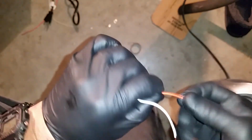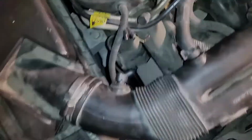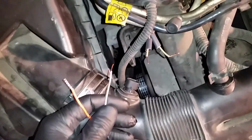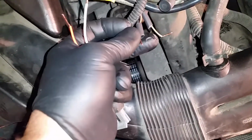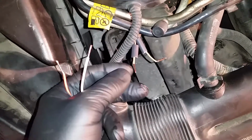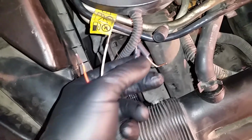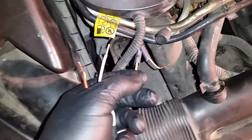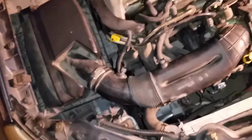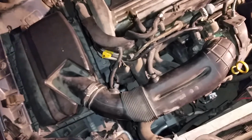What I'll do is I've got the wires on the car ready. Okay, now I'm going to put the wires back together and solder them, and then I've got, you can see, my marine heat shrink tube here, which after I solder them, I'll put this over there and melt it, and they'll shrink down, and it's got adhesive to keep the elements out. And then after I'm done with that, I'll take friction tape and wrap the whole thing in friction tape,